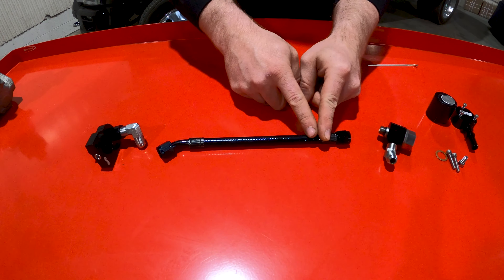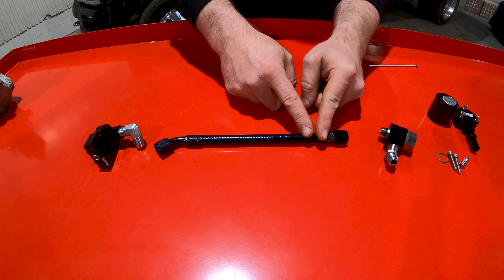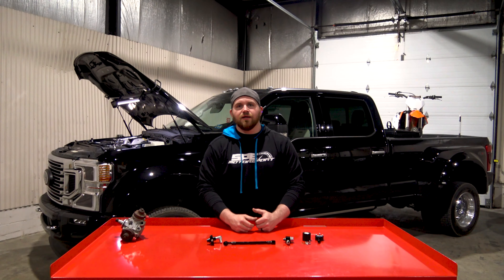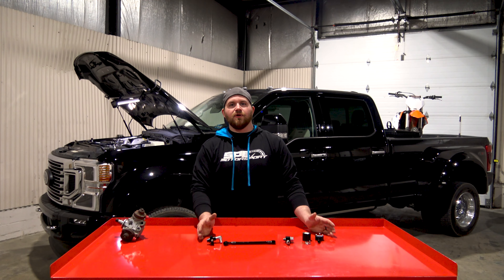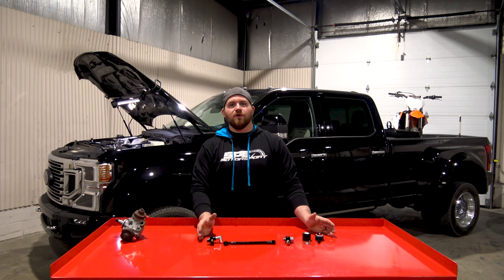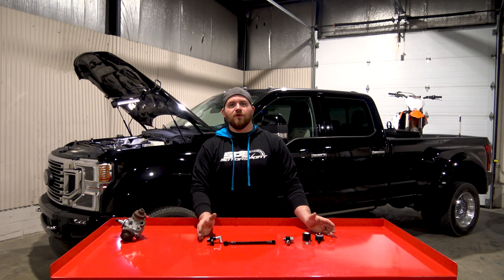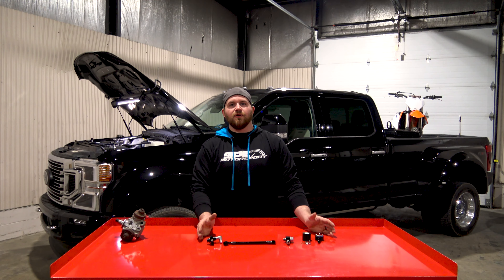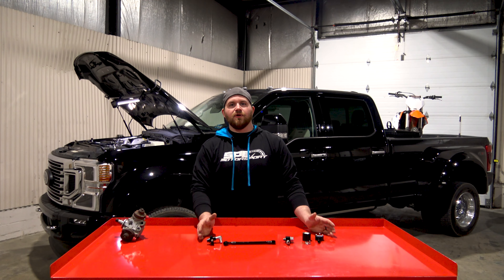There is an O-ring on the top as well, so everything on this kit is pretty much an O-ring seal except for the hoses and the fittings for the manifold to the MPROP adapter. This is a Dash 6 Fragola line made in the USA — it's a great quality hose. It's aviation style hose and fittings — JIC AN Dash 6 hose ends with a Dash 6 hose. They're stainless steel braided hose with a PVC liner on the outside and a PTFE liner on the inside.